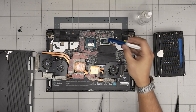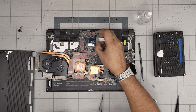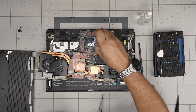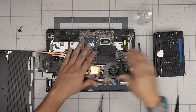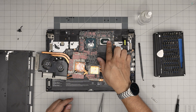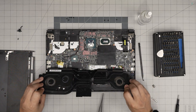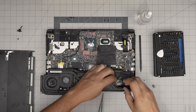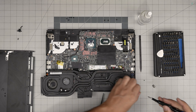Next, apply one line of thermal paste on the CPU and an X-shape pattern on the GPU. You don't have to spread it — the pressure and heat will spread it evenly. If you want to use PTM, just put a PTM sheet on top, then place the heatsink over. Also make sure you always clean the air duct area for the fans — people often see the fans look clean but don't open them to clean thoroughly inside. That's very important.